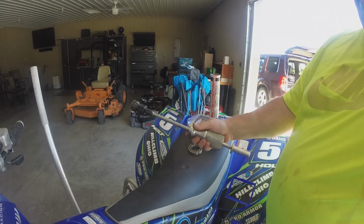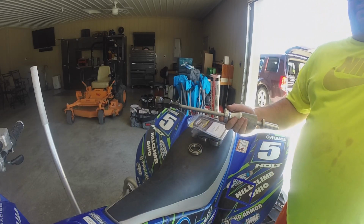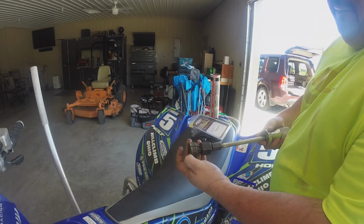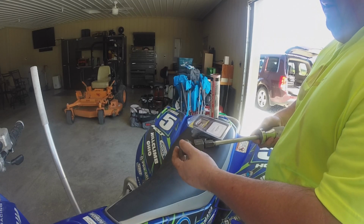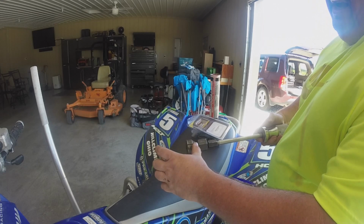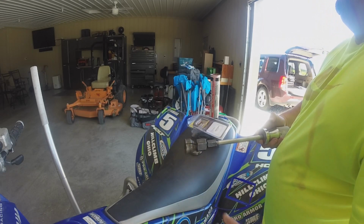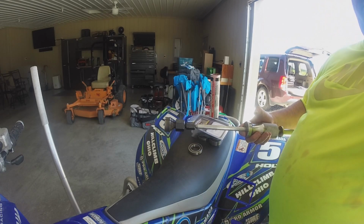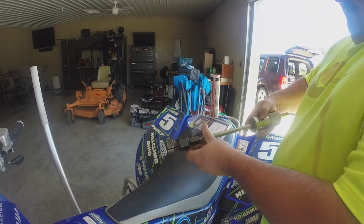But this slide puller, this is a great thing. So I've ordered a smaller one, I got it off of eBay, and it works the same way, except the tool is smaller, because this is a 40. I think the smallest you can get this style in is down to a 25, and it won't fit through the front bearings. So the ones that I'm getting are longer, and then you run a bolt into them and they expand out. I think it goes down to maybe 10 millimeters or so in diameter, which is close to about 3/8 of an inch.